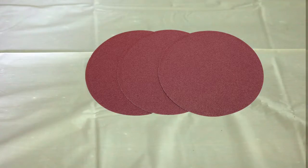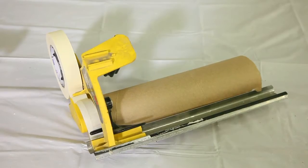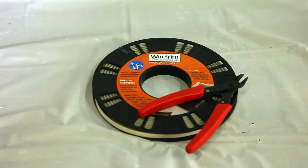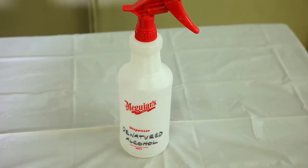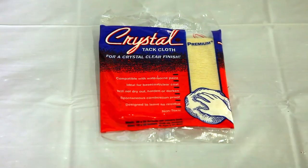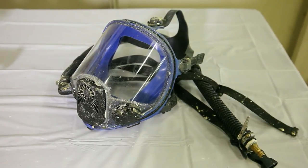60 grit sandpaper is ideal to sand all areas in the corners and near wire tape lines where the cut brush can't reach. Masking paper and masking tape are necessary for covering areas of the truck that do not get coated. Wire trim tape is essential for defining clean straight lines where the exposed factory paint and the Rhino Linings protective coating meet. Denatured alcohol or tack cloth is important to remove dust and debris from the vehicle. Please do not smoke or use solvents near an open flame. A dual cartridge respirator is essential to wear when exposed to fine sanding dust and solvents.